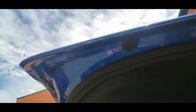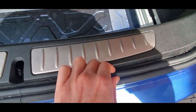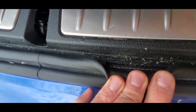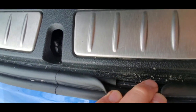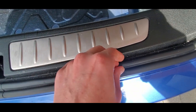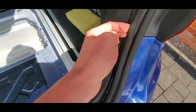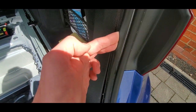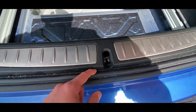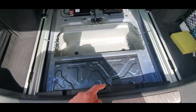I think what I'll do is buy another strip, peel this back — I put a little piece behind there — and carry on with the strip all the way under here. That will lift this piece of rubber up higher the whole way, because there seems to be a little bit of moisture on the inside. I'll feel more confident with another strip all the way, just to lift it further. The key is to stop water going down into that hole. For now, that's fixed it — it looks like it was the boot rubber which was responsible for the leak through that hole.